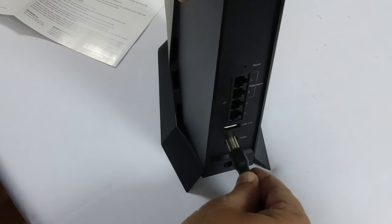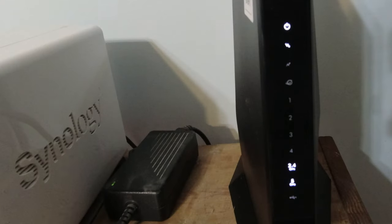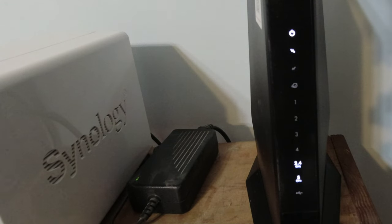I'm a little nervous but let's see if we can set this thing up. Connect your cable, connect your power cable to the back of the modem, and plug in the power brick. When you plug it in you'll see all kinds of lights start flashing — that is absolutely normal. There's a light that looks like a globe with something going around it, and that has to light up. There it goes — that can take up to 10 minutes or so.